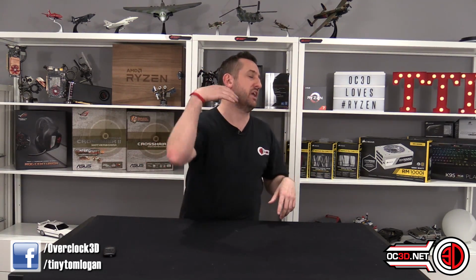If you've got a 7700K, then the only reason why you're going to be wanting to jump ships and go over is because you're just fed up with the same thing being regurgitated over and over again in different chipsets. We know that the AM4 socket is going to support all of the new AM4 CPUs, right from the APUs at the bottom up to the 1800X at the top. So we're going to get 2 cores with graphics on it, we're going to get 4 cores, we're going to get 6 cores, and we're going to get the 8 cores.